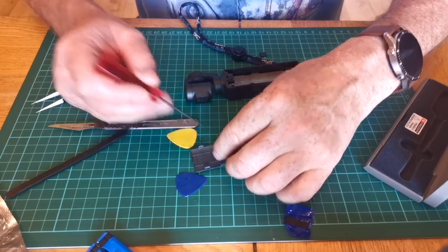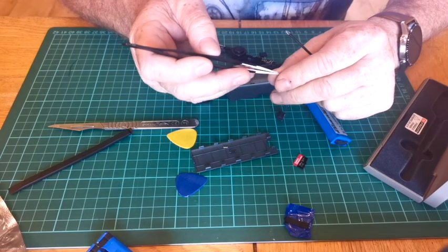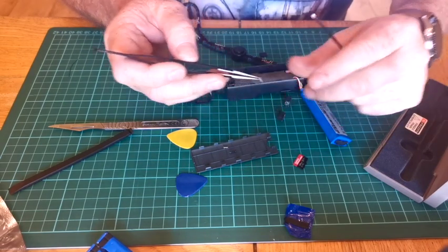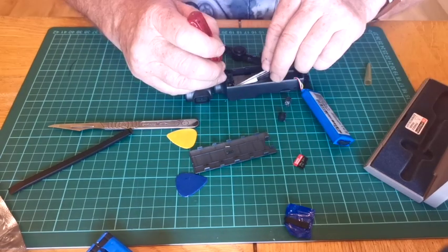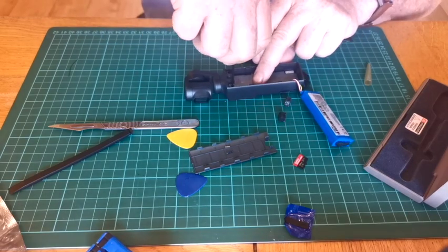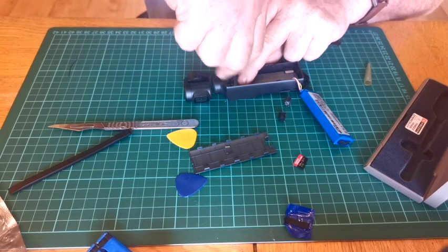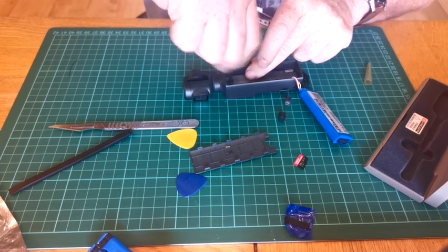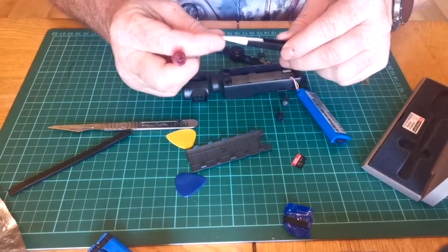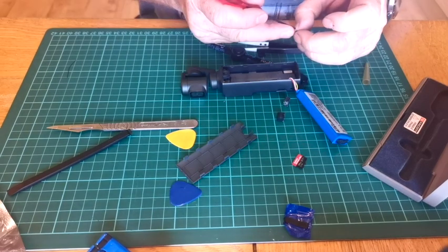Got the A4 screws and the non-magnetic screwdriver, obviously. So just get the little fellas back in. A little turn the wrong way and you'll feel it tick as it drops back into its original thread. Always a good little tip when screwing into plastic. Second one from the other side. Last screw in the bottom.